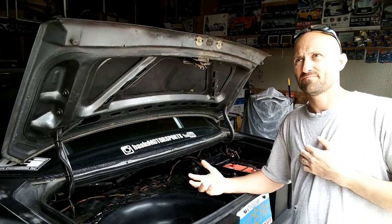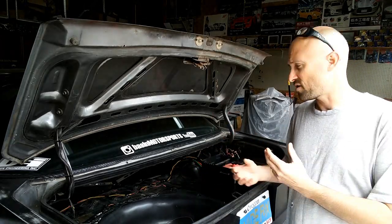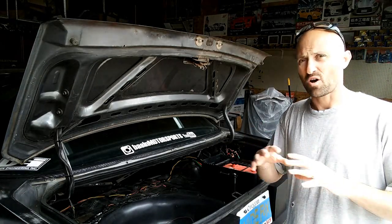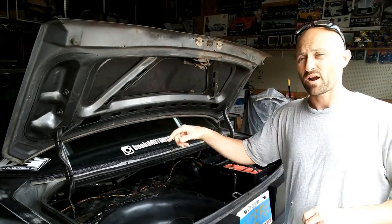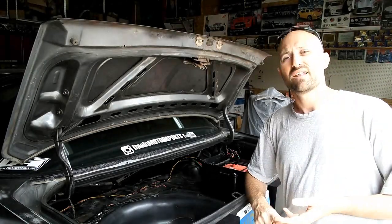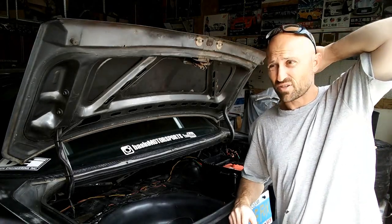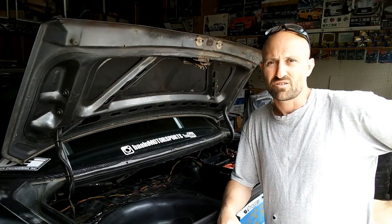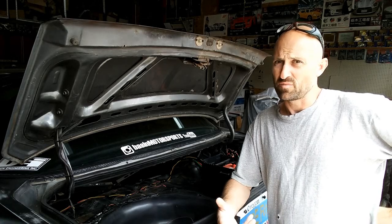So I knew the 80 was probably bad. The 92 solenoid I put in the car, and that's the one I've been using as a mock-up. I took out all the switches, really, and went directly from the ignition key to the wire all the way back to the solenoid. Hooked up the battery, hooked up all the pieces, and nothing. I couldn't figure it out. I thought, this solenoid has got to be good, because it was good two years ago. So I debated, could it really be the solenoid?